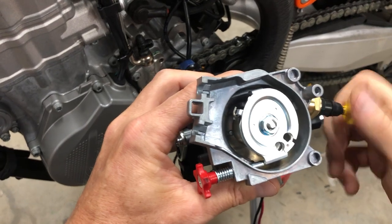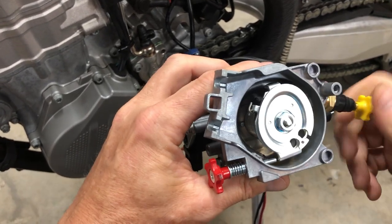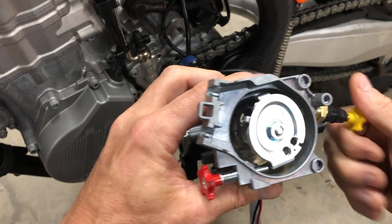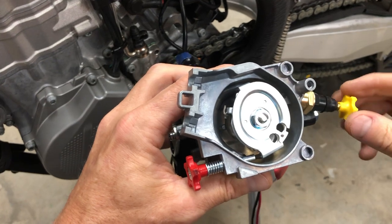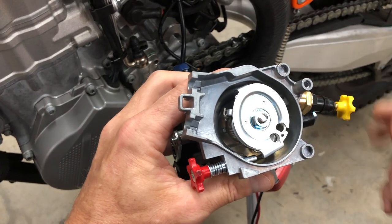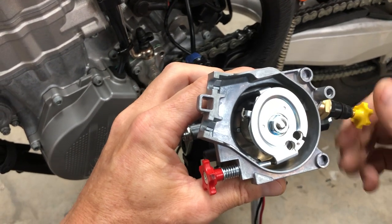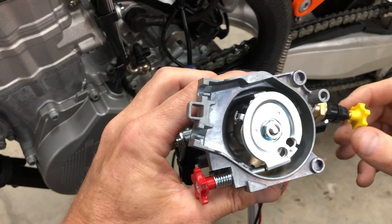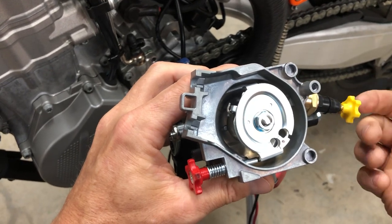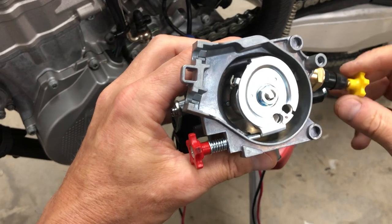And then when I start to crank this in, you'll see at a certain point my gap begins to appear, and then I can over gap this thing to now the bike could be running at a very, very fast idle until it goes to a stop again. And so that's a very large gap. And so you basically fine tune your fast idle speed wherever you think is necessary to get you a nice warm up on your bike without over revving it. So there's no real spec. Well, I say that, but there probably is.